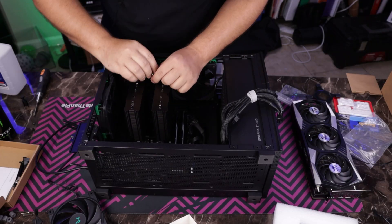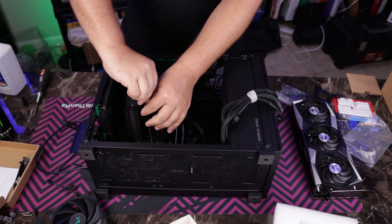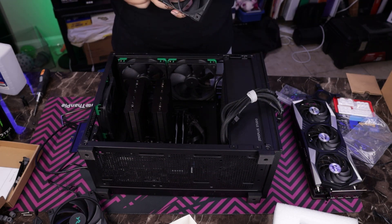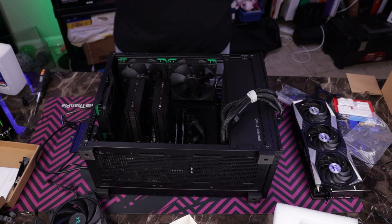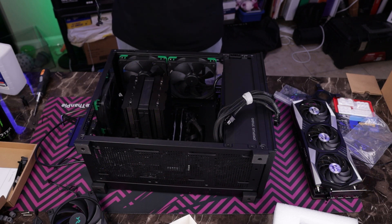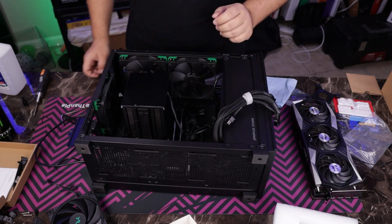The install of this cooler is actually pretty interesting. The screen itself is held on with magnets and has a cable running through the center channel of the heatsink, held in with just a bit of friction — so it's much easier to remove than I expected. The install requires removing the middle fan, the screen, and the rear fan. After that, it's similar to a Noctua SecuFirm-type install: you put standoffs into the default backplates and screw it down with two screws and the included screwdriver, then reassemble by putting the fans and screen back in.